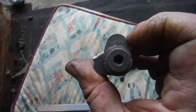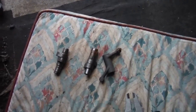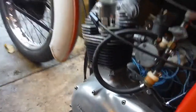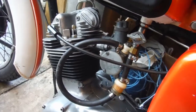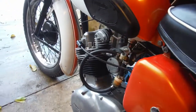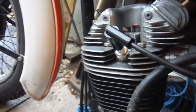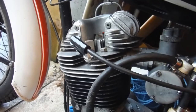The R cam also works through the same kind of rocker, which also increases the lift imparted on the valve. I've measured the lift of the exhaust valve on this engine and on my Trials Cub replica engine and they're the same — and I know the Trials Cub replica has a standard cam. So we've got a standard camshaft in this engine, meaning we want 10 thou inlet and 10 thou exhaust valve clearances. It would have been 4 thou exhaust and 2 thou inlet for a sports cam. You can actually run a standard cam tighter than 10 thou — I'm not sure why they used those settings, perhaps to give learners more margin in case they got the clearances wrong.